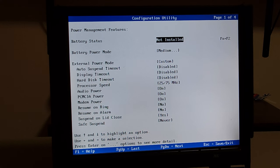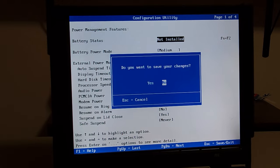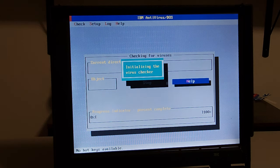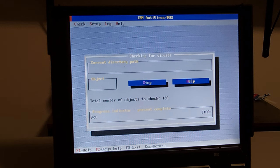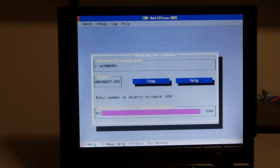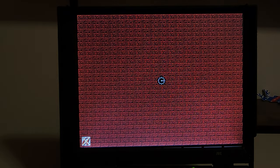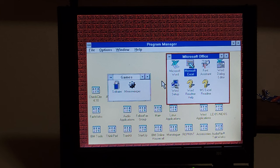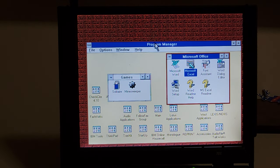I'm not going to save any changes since I didn't make any. Let's see if we can just start the PC — it's actually working. Checking for active viruses in memory — well, it hasn't been used for quite some time. It was set to do a virus scan, and now it's starting Windows 3.1. Look at that — it's got a nice screen, nice mouse pointer. The only issue is that hinge which I think we can fix pretty easily. Everything seems to work even with a little bit of bad RAM. That's awesome.